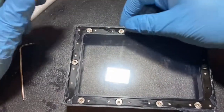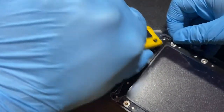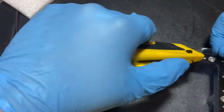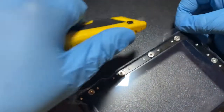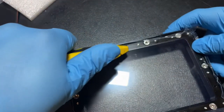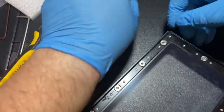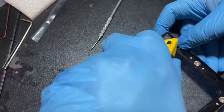Very carefully, I usually start by cutting the excess corners so there's a little less rigidity and it's easier to flex everything. Keep your fingertips out of the way. Then grab one corner, put the knife down along the edge, and slow and steady wins the race — right along the line up against the metal part of the vat. Here I'm getting the last little bits off with a pick to get the corner, so it doesn't drag on the screen.